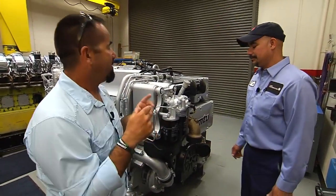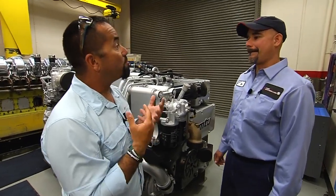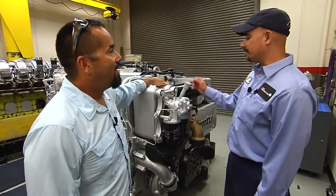change the fuel filters. Every once in a while, you get some air in it, and you lose prime on an engine. On a diesel, it's a killer. You're not going to start your engine if you have air in the system.